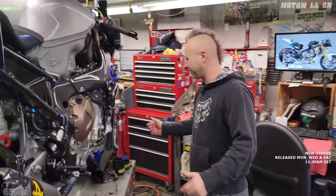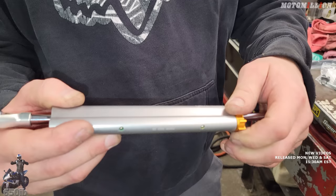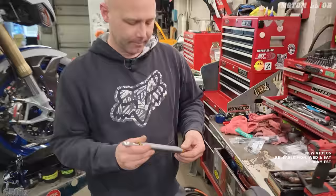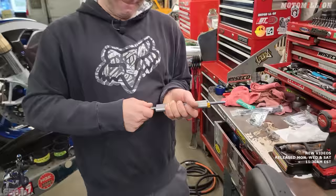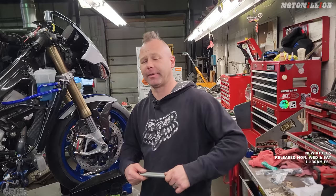Just been doing this for five years now — I've learned something. Our Ohlins unit, the adjuster's on the body itself, which makes it a little trickier to get to. So that's soft on the Ohlins unit. Once you put this one on firm, you can barely even move it — be careful in parking lots. We usually set them somewhere in the middle, and you just stiffen it up if you're going to go out on some high-speed straightaway stuff, which we're known for doing.